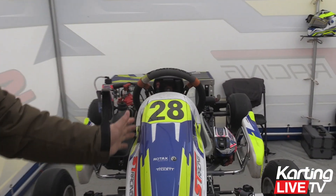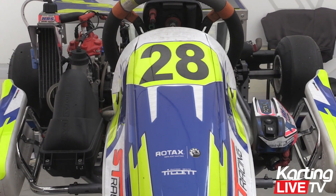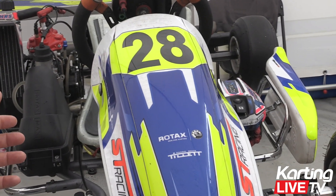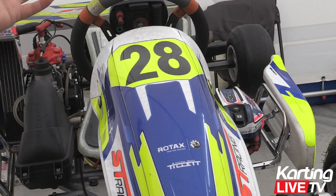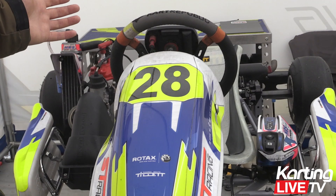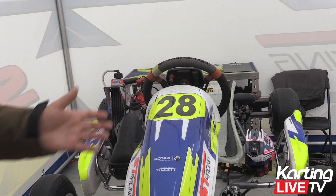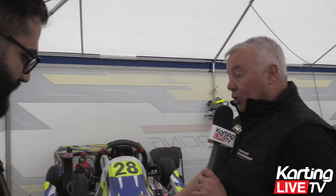Towards the end of the nose panel you've got some ducts, and basically what it's trying to do is push the air outboard as easily as possible to reduce drag. You want to reduce drag because the driver is essentially a brick going through air in a straight line, and the best way to do that is to optimize it by pushing the air around the driver. So this is the one that — even I understand — it's about cutting through the air as fast as possible.